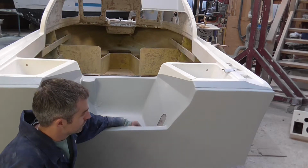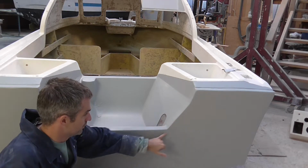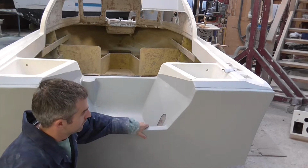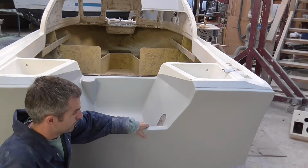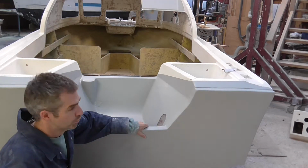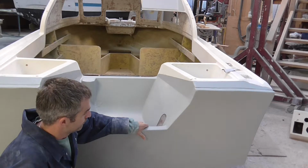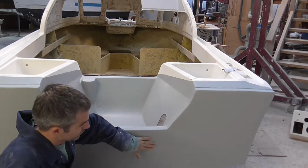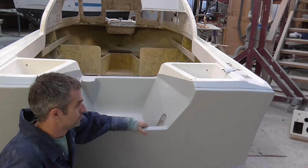From then onwards, once you've got the glass join through there and glass behind, it's just all detail. So what we then do is we'll come back over and flow coat the join. That seals off all the pores and basically fills all the pinholes, sand that back, and then we hit it with this grey primer over the top.